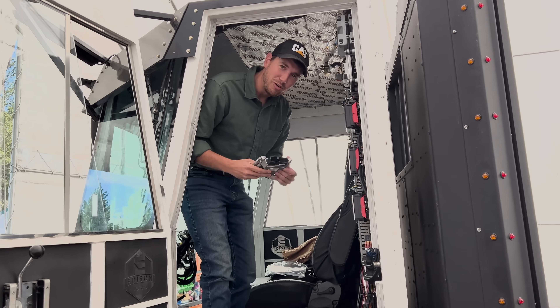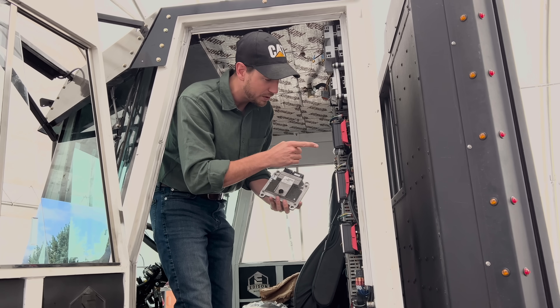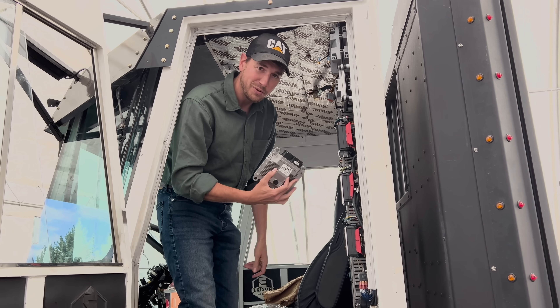We're going to replace the TCU here. This unit will now command proper torque values for the other axle and hopefully be up to speed going the right direction. If you remember, we were having problems with the regen on that first axle. One of the issues we couldn't program ourselves — that was from the manufacturer's program. Eric actually had to hop on a plane, bring the TCU, and get it reprogrammed at the factory. We were trying to do it remotely, having issues, and it was quicker and easier to just fly there and have them reprogram a new one.